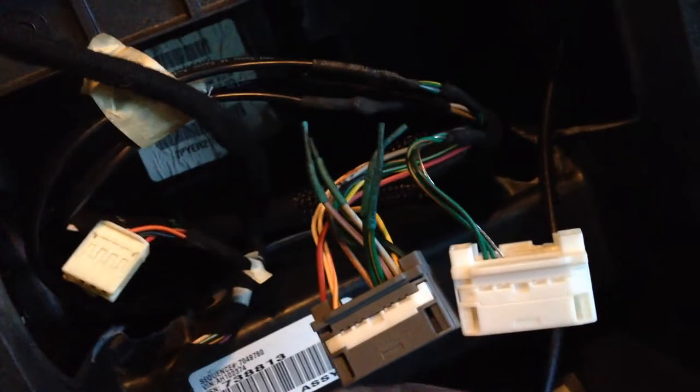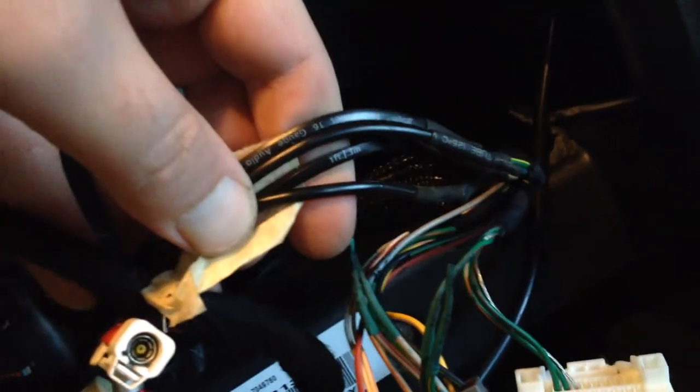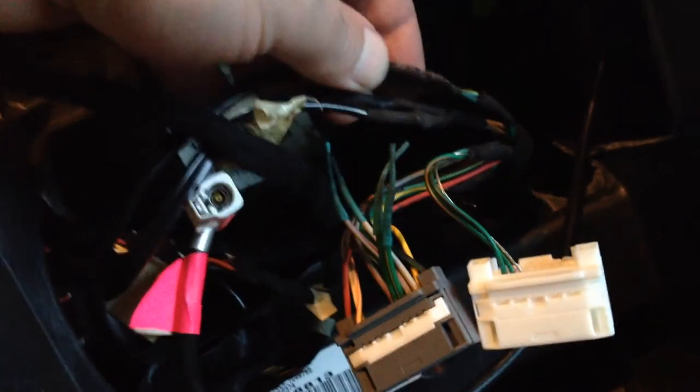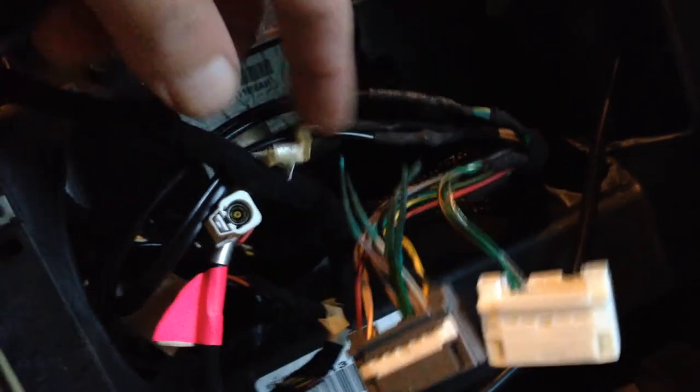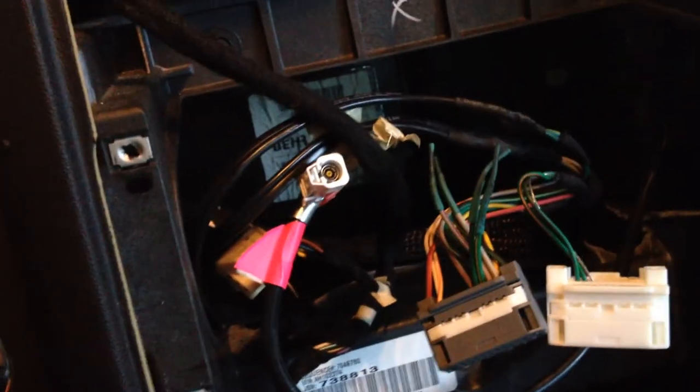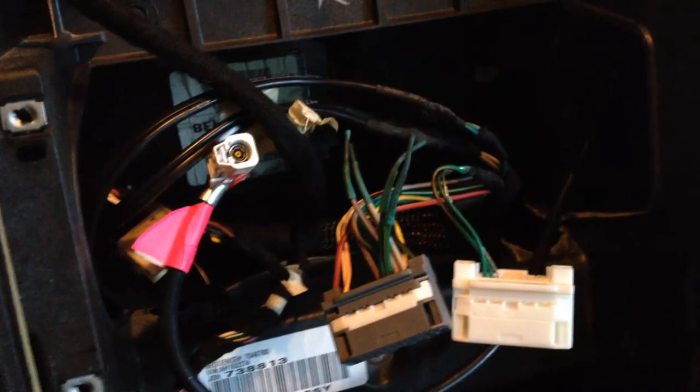When I installed the amplifier in this car, what I did was bring forward a set of four wires from the back that are hooked to two of the channels of the amp — say left and right. I cut the factory end and spliced these into the factory wires so they would feed the speakers. We're going to remove that now because we're sending the car back to factory. I'm going to pull these wires off, re-splice them matching colors to colors, and we'll be back to factory as far as the front end of the system goes. When we get to the rear end of the system, we'll do that in a separate video on how the amp went in and how to wire it up.